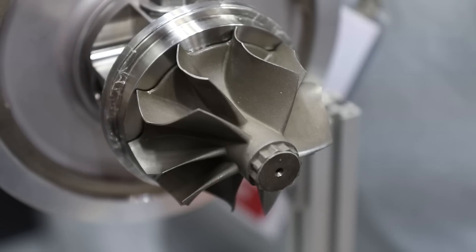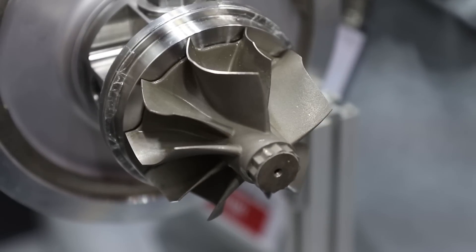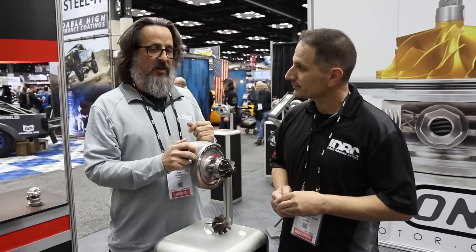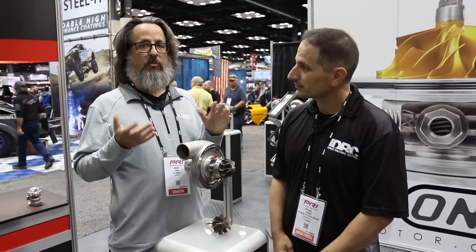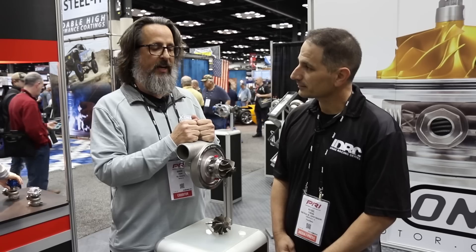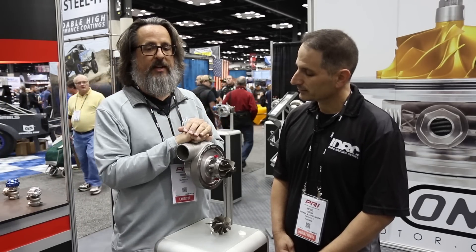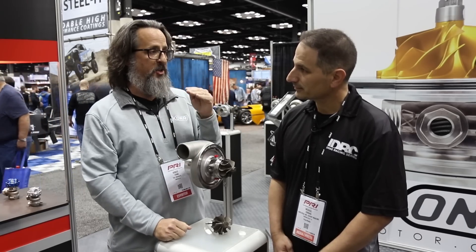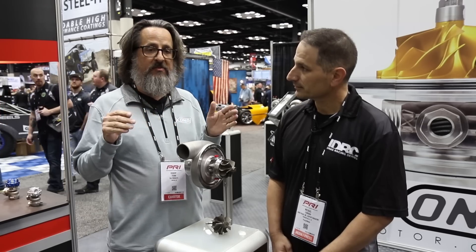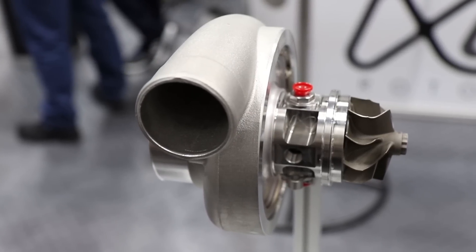That's exactly right — you're capturing all the energy out of the engine to drive the turbine, but at the same time you're not choking it with blade clogging the outlet. We recently tested this on a 997 equipped with a pair of 65 pound-per-minute turbochargers — approximately 1,200 to 1,300 horsepower at the crank. Running the turbochargers at a 330 kPa boost target, we saw between 6,000 and 7,500 RPM an increase of 100 wheel horsepower as a result of how much easier it was for the engine to exhale.